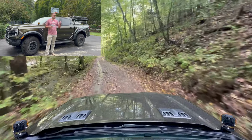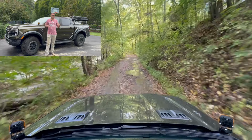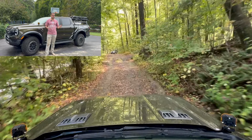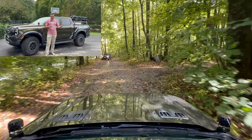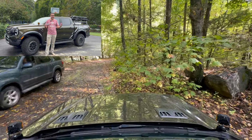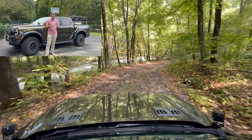Those numbers don't make sense. They wouldn't graph on a line perfectly, but that's just driver error, you know, little bit of differences on the launch, things like that. But what I'm trying to get across is, say, an average density altitude of negative 1,000 and an average time of 5.8, because we've got a 5.6, a 5.9, a 5.7, a 6.0, and a 5.8. So we'll say 5.8 is the average, and the average slope is about, I'd say, 1%.